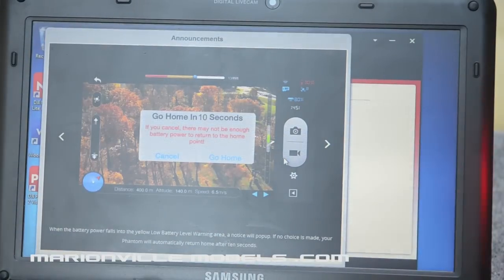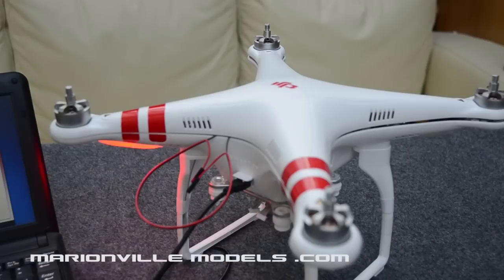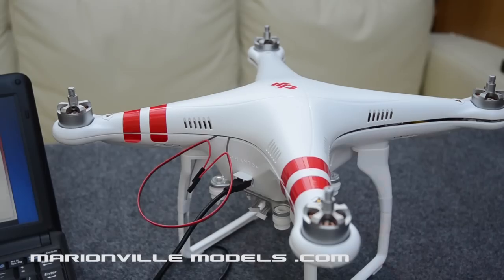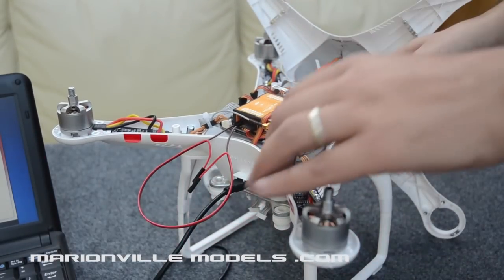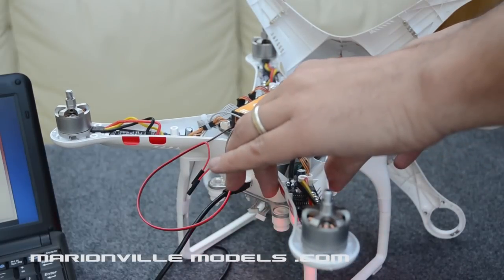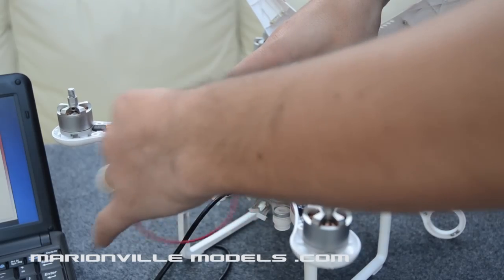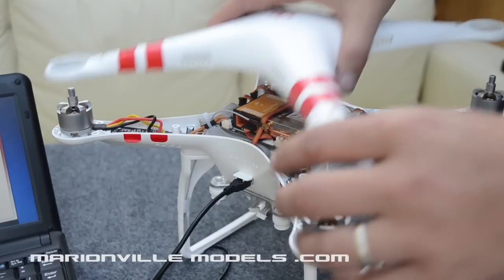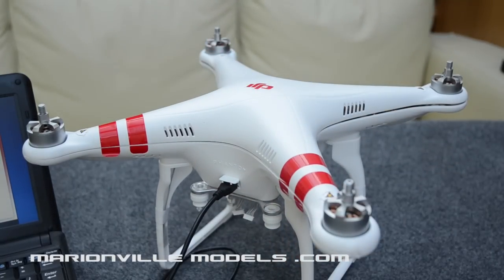Here's the key part. What we need to do before we get any further — because we're going to power cycle, which is basically turning off and then on again — first thing we'll need to do is power it down. But before you power it back up again, you need to remember to remove the jumper. Take that off, lay the lid back on, and then we're going to power it back up.